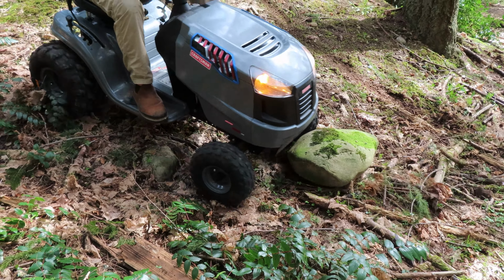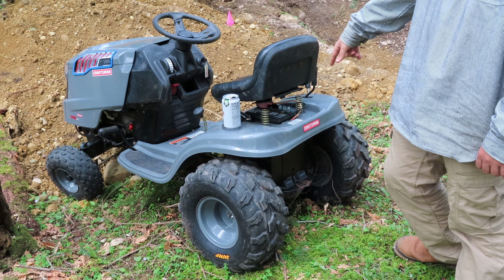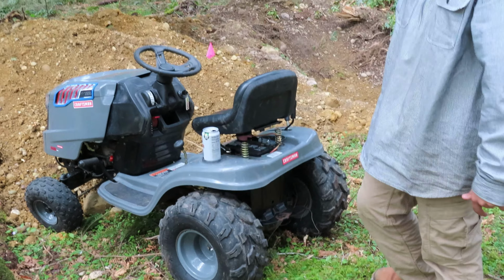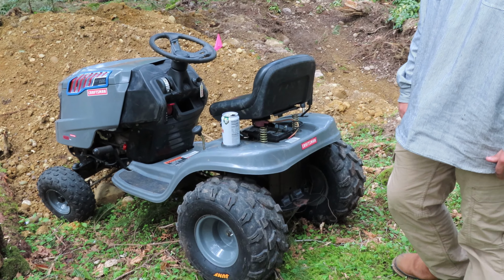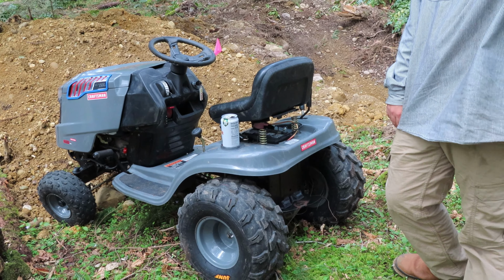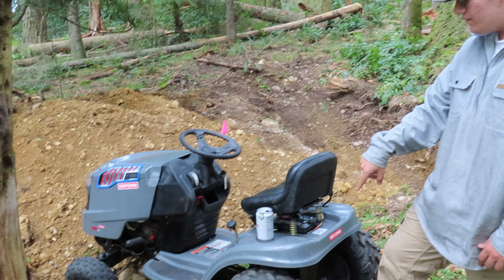What that means, luckily, is the axle in here is in a carrier system, an enclosed space, so it's really not that hard to weld back again. I wonder how that came apart, or if the welds broke. We welded it to the outer case. Because you can't reach in and weld the spider. So yeah, tip for LT1500 guys, you can't really weld into the spider gears that well.